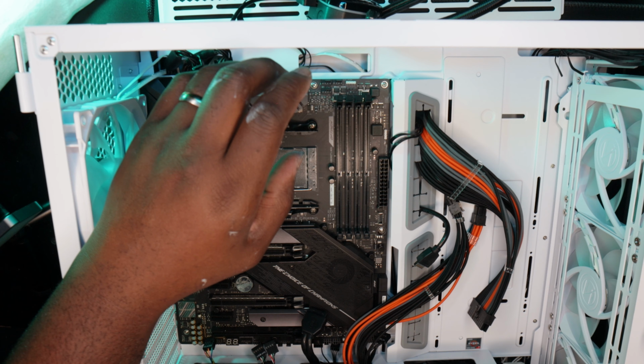Okay, what do I have? Oh, okay, hold on. Let me get into my toolbox real quick. There we go. Make sure there's no bent pins. Let me put this to the side for now. The paste is pretty thick. I think, what did I use? I used the MX4. MX4 means business. All right, got some alcohol to help clean off that residue. I don't want to leave too much mess on the motherboard, so hopefully this will be just great.